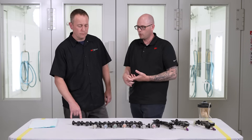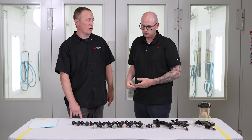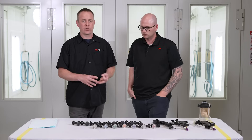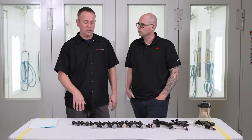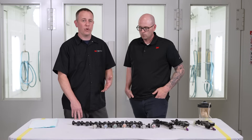What about 1.2 up to 1.4? Those are pretty much the workhorse sizes. You're going to use those for your sealer, your base coat — whether it's solvent or waterborne — and your clear coat for the most part. Again, depending on the clear and base coat you're using, check the tech data sheets. They'll tell you which size to use, at least which size to start with, and the pressures.